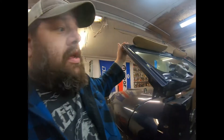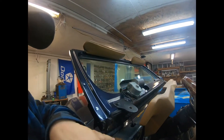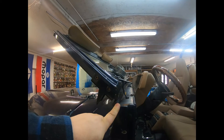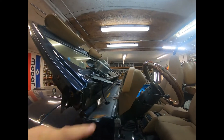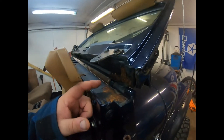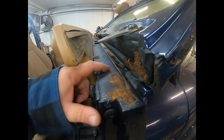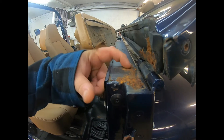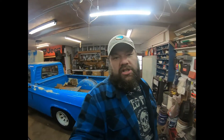Another thing to look at on the body — and I'll keep this as number two — is fold your windshield down and look right in here. This has a tendency right down through there to get water, gunk, and different things, hold it there, and create rust. This one's not too bad, that can be easily cleaned up, but you can see it's pretty heavily pitted right there and very thin at that spot. We can mitigate that — for the end user that's not going to be an issue for this Jeep.